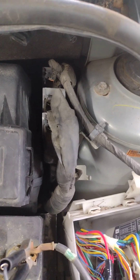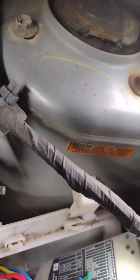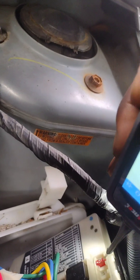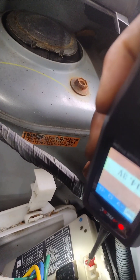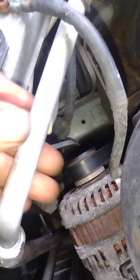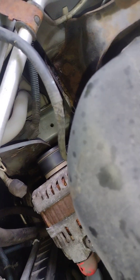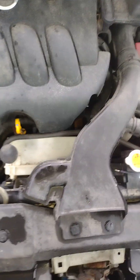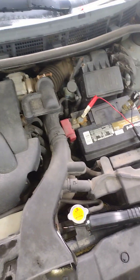Now you can hear the compressor - the clutch is working. I put a new fuse. Let me check - 14 volts and also 14 volts on both sides. That means the fuse is working. Let me see if the clutch is engaged. Yes! The compressor is engaged - you can see down there the compressor is working and the line pressure is up. Wow, it is icy cold! The new compressor started working now. So the fuse was bad because the clutch burned out the old AC compressor. Thank you, I'll see you in the next video.